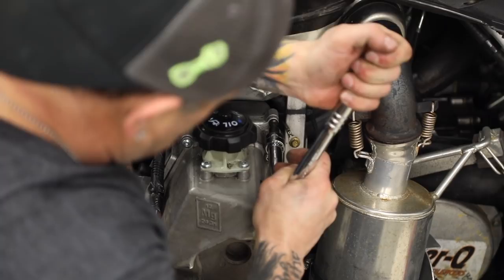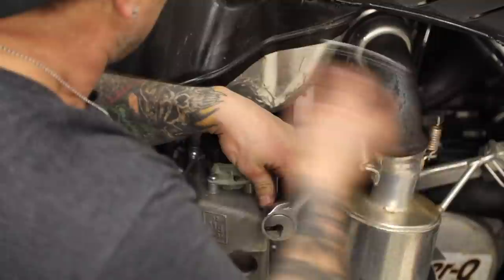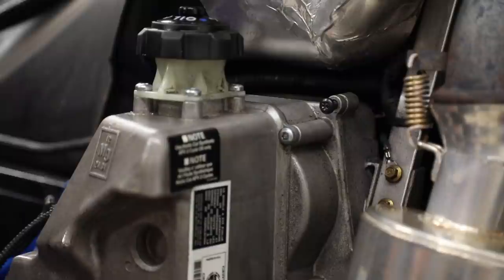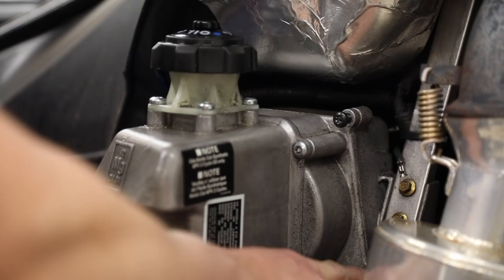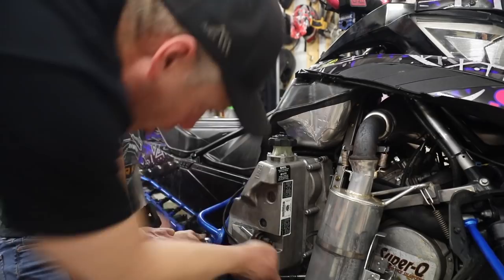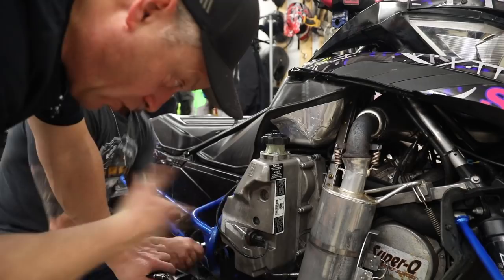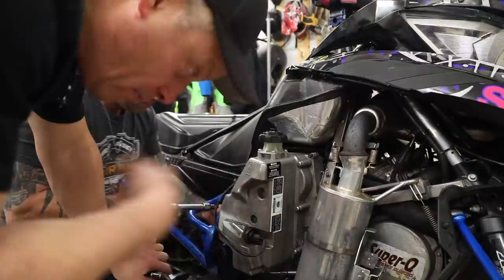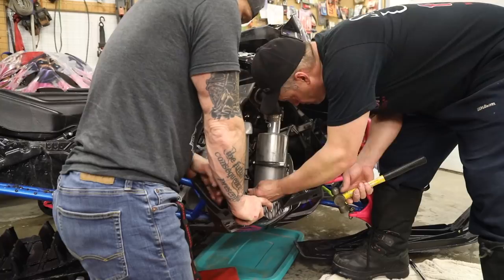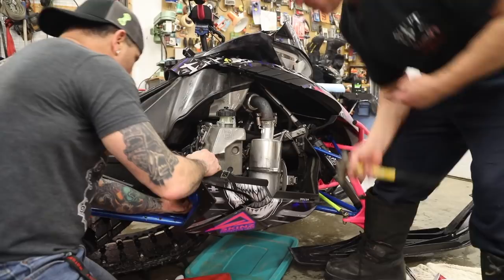Corey is trying to take a bolt out of the chain case and having a really hard time at it. Look at all those muscles going to work! You don't want to take the oil tank off of the chain case cover because it's siliconed on — then you've got a whole world of other problems. So we're taking all these little black bolts out to hold the chain case on with the oil tank cover. We're going to unhook the oil pump on the bottom, probably make a bit of a mess, pull the chain case cover off, drain all the oil into a pan, take the sprockets off, and then jump to the other side. Here's some real life guys — we've got a stripped out Torx bolt. We're going to try to fix it.